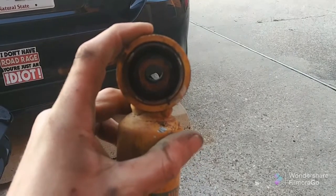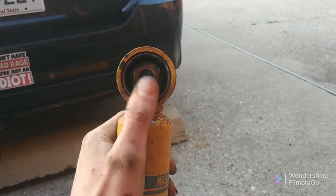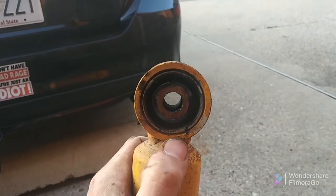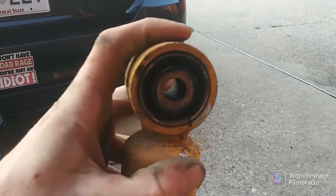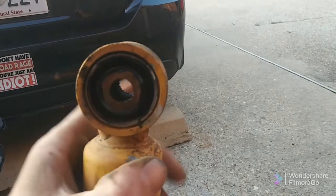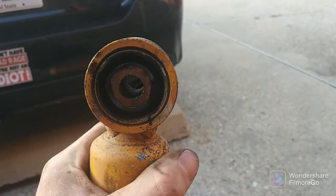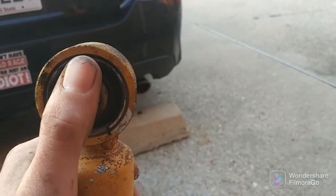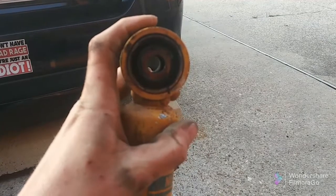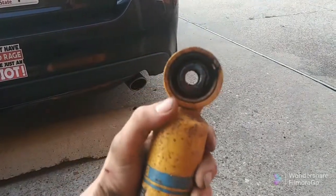Wow, this thing really sucks at focusing up close. It's okay. And I'm going to clean the bolt hole up. It'll be alright. It's still very warm. But yeah, I'm going to buff this down and get some clearance on that as well. I'm not going to take a whole bunch of material out of it. I only need maybe a 1/16. I just don't want to pull down on the bushing, and I don't want to have this rubbing the bottom of the mount.